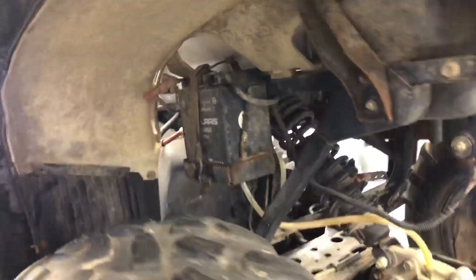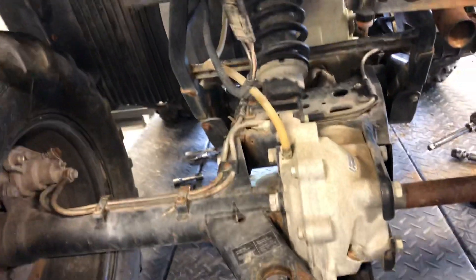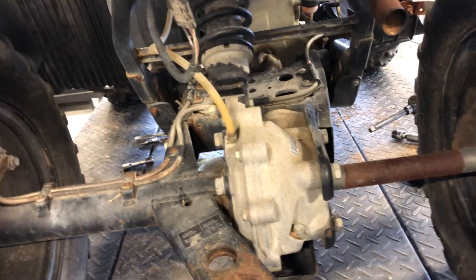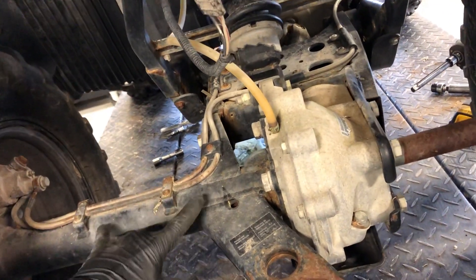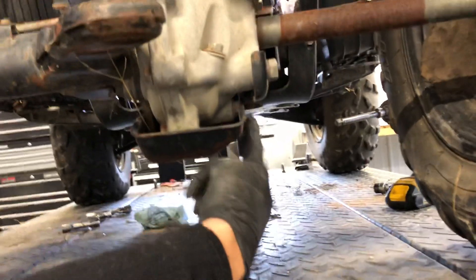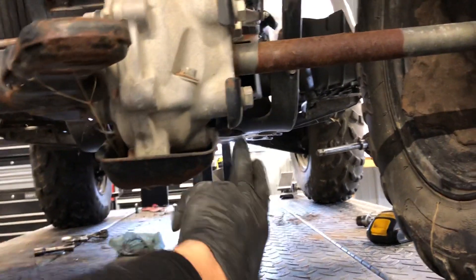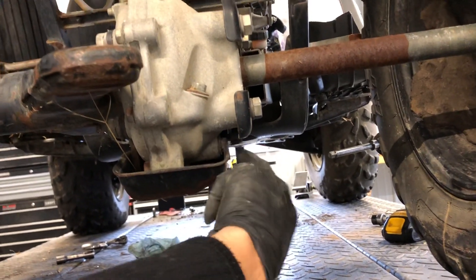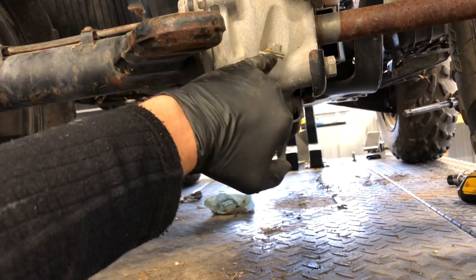On your back end, we've got hydraulic brakes on the rear, on the left-hand side. We've got a place to put a ball hitch — any standard receiver ball will fit in here. We've got your rear differential — this is a solid rear axle. To drain this oil, there's a drain plug down below. You can get to it leaving the skid plate on, but I like to pull the skid plate since it gets messy inside. The drain plug is a 14-millimeter. Your fill bolt is here — same as the front: fill it until oil is close to the top, and you're all set.